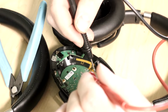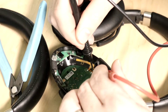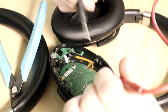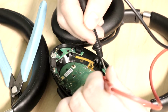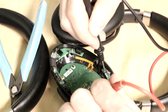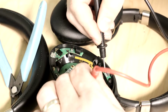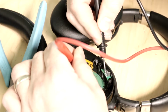Wish I had known that, because that means it really could have stayed connected. Because I need this ground plane here. Wait, the ground plane is already there as well. Wow, that's great to know. When I did this one, I should not have taken off that switch because one of the legs is already where I needed it to be, and literally all I needed to do was take a wire from here to here. Then that's the whole fix to this when you have a working unit, which now I can't do because I've obviously done something else to that. But that would be the fix. But now I've got to find out where this other wire is so I can connect it to ground. That's all I've got to do, is connect it to ground.